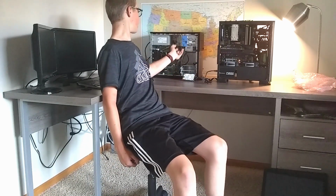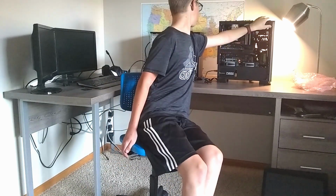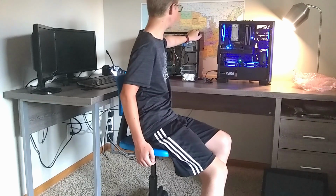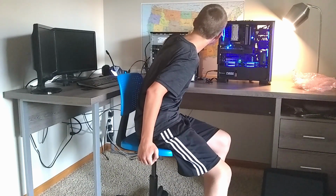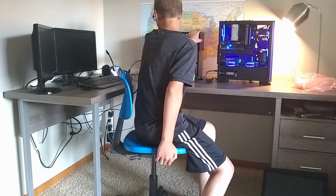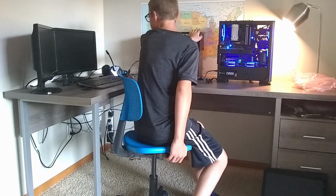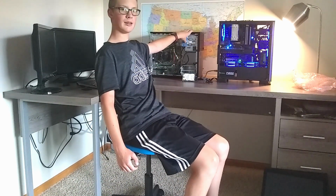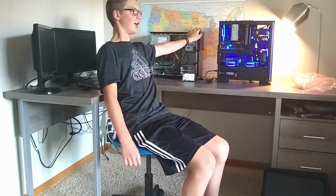I also just put another 2 gigs of RAM in. Now it's using just two 2-gig sticks of OCZ Gold RAM. For some reason, those work fine in that, even though the other RAM didn't. But let's power it up and boot into the Windows installer. Okay, the hard drive has power. Okay, I guess it's not wanting to boot with this, so let me go through and see if I can figure out what the issue is.